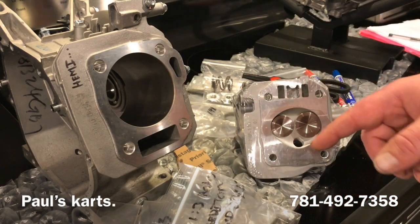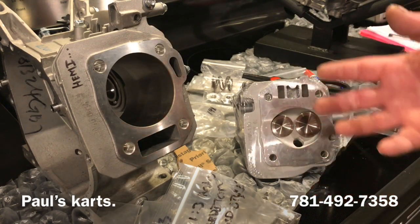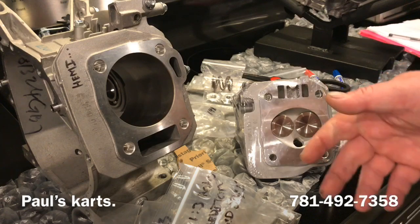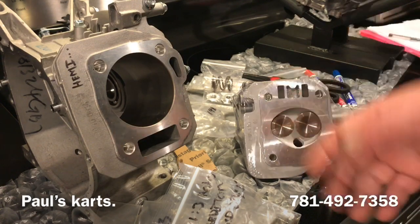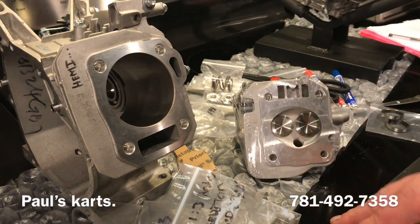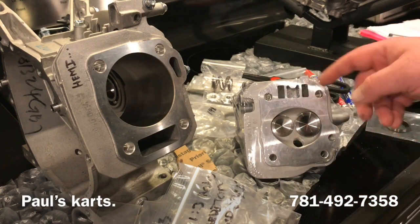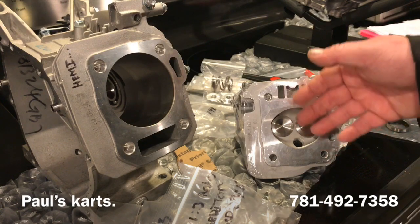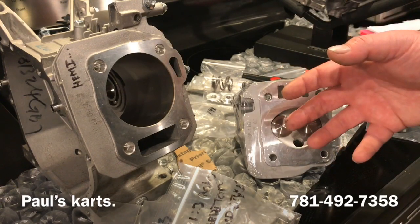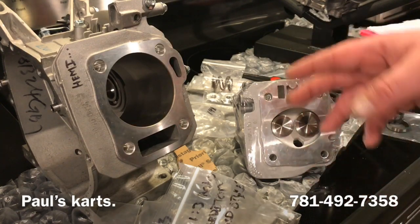is one of the reasons I actually built a custom box that shows me how, a lot of people just focus on the flow bench. I have videos in my playlist where you can see I did work on flow benches, got some great numbers, which gave me a great port design. And it was a necessary step. But that just takes it from the carb to the back of the valve. The next step is, what does the air-fuel mixture do once it's entered into the cylinder? Maintaining all of these things at optimum levels through the entire 4 cycles.